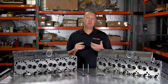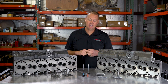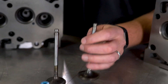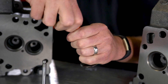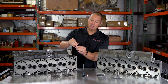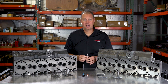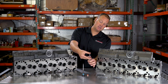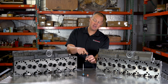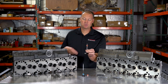We also offer this with OEM valves and valve seals. There are two different styles of valve seals that typically come out of Cummins. The stock seal sits on top of the valve and its job is to keep oil out — it's an oil scraper. If you're burning a lot of oil, maybe your seals are bad. The problem with this stock setup is anybody who has turned their boost up will open their valve cover and see the seal has slid up to the top — it's no longer sealing around the valve stem. High boost is really bad on these; it pops them right up.